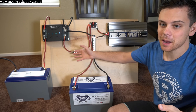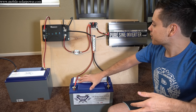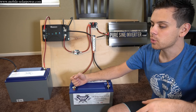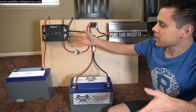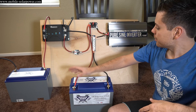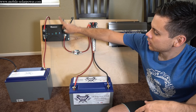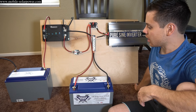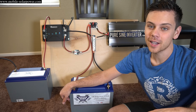I liked this system so much I built a small example installation with a 1500-watt inverter, a solar battery bus bar, circuit breakers, and the Renogy DC-to-DC with MPPT — with high-definition pictures on my website. I want people to build it safely, so I'll also list UL-listed marine-grade circuit breakers and explain what size wire goes where. It's a straightforward process: a bus bar and circuit breaker, two wires out to this unit, two wires up to the solar panels, and a single four-gauge wire to the starter battery or alternator — then ground everything and you're done. Please check out the website. This thing is really sweet and easy to use.